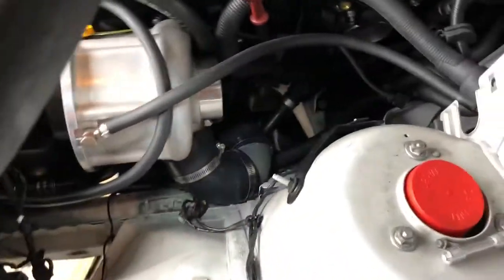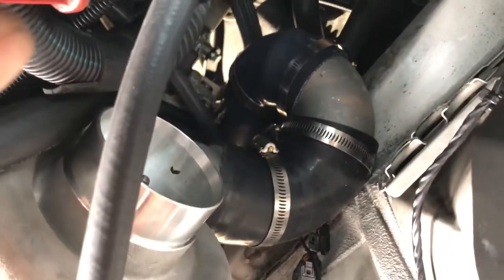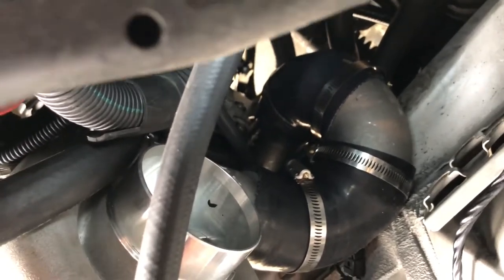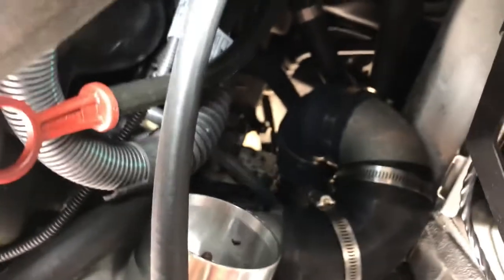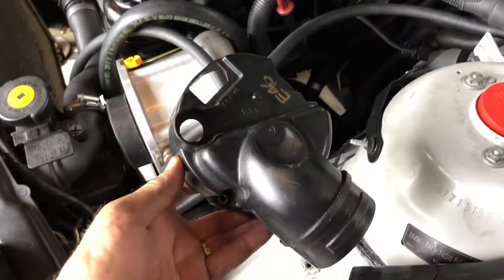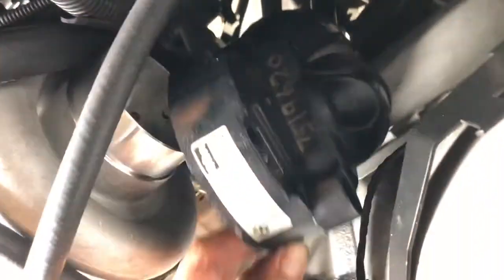Okay, now it's February — we have an update. Been procrastinating and not doing anything about it, but anyway. I've just managed to hook up this boost pipe from the charger down to the intercooler. The hoses aren't quite lined up but it's looking like it will actually work. I had to take the cover off the back of the alternator, so I'm gonna have to grind that down because it has a big vent on it for cooling. I'll cut this section off — there's no way that pipe is going to fit in there with that pipe right in the same real estate.